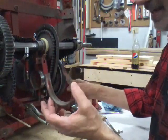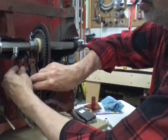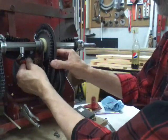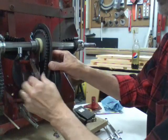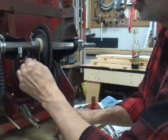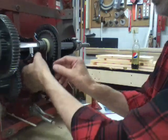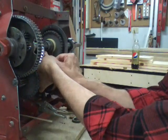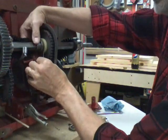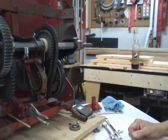Stick your brake band back around your hub, get your linkage back in there, brake band back on. Then you've got a washer, a lock washer, and a self-locking nut — get that back on there. Sometimes they'll screw on and tighten up fine, and other times they won't.